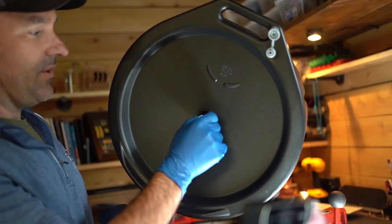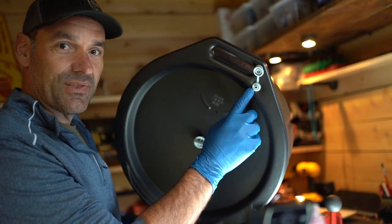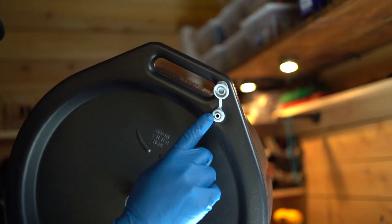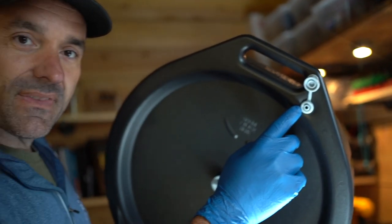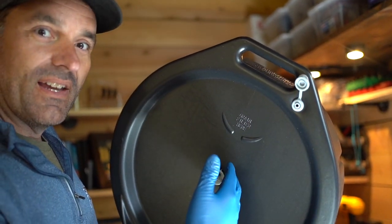And we gotta unscrew the container and make sure that the drain plug, the top one, not the drain plug on the side, the top one, is actually open so that the air comes out as the oil goes into the pan.